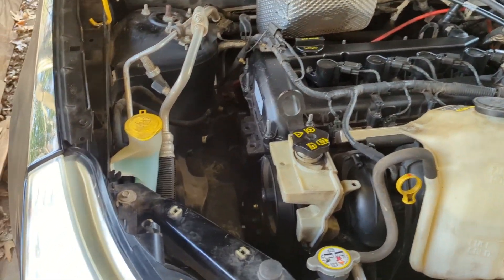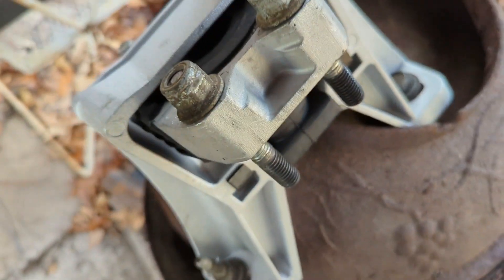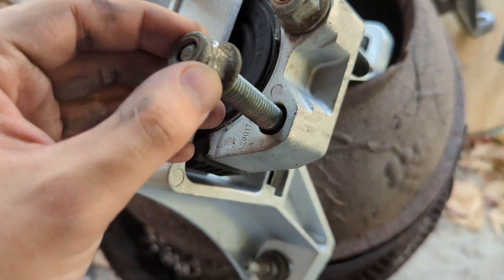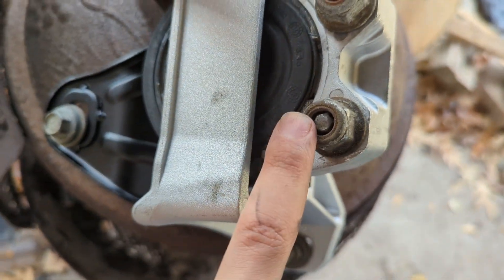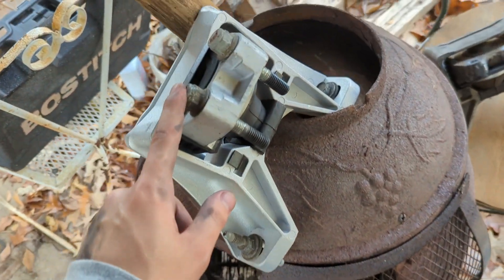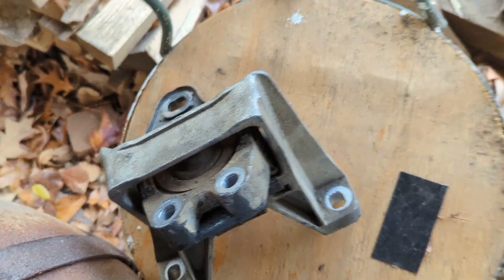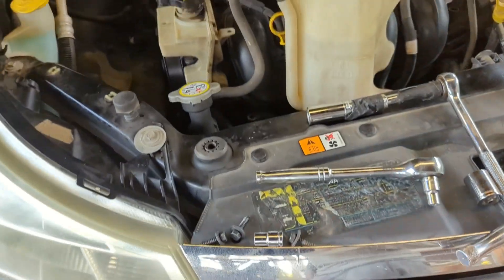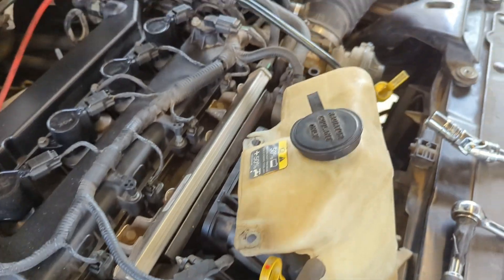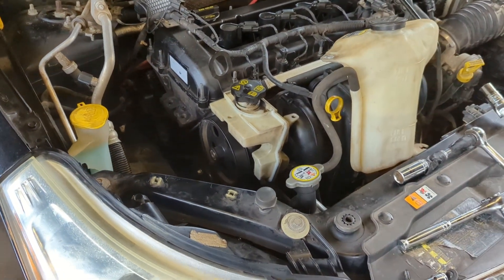I did a bit of work off camera undoing all those bolts and, as you can tell, there's no more engine mount. There's the old engine mount all messed up and destroyed. Now, one thing to note: the 18 millimeter bolts are actually attached to studs, and the top of these studs is actually an 8 millimeter. So once you get these bolts off, you'll need to use an 8 millimeter socket to get these studs out of the engine mount if they don't come out with the bolts — which they almost certainly won't. Then you'll just have to do a bit of maneuvering to get the mount out. Make sure you've got your jack under the car supporting the motor; you'll have to move it up and down a little bit to get enough clearance, but not too much or you'll risk breaking things.